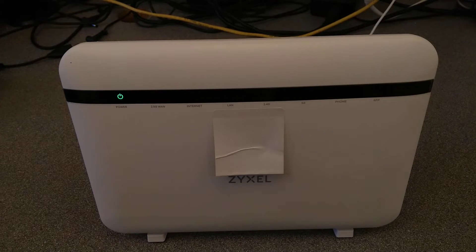Be aware that if your internet provider gave you this router, they may have their own custom defaults on it. Doing a factory reset may take it back to the ISP's defaults and not to entirely blank. So for example, if there are PPP settings stored within it, or if your ISP restricts access to some of the web admin pages, that would also still be restricted if they've set their own custom defaults for when you reset it.